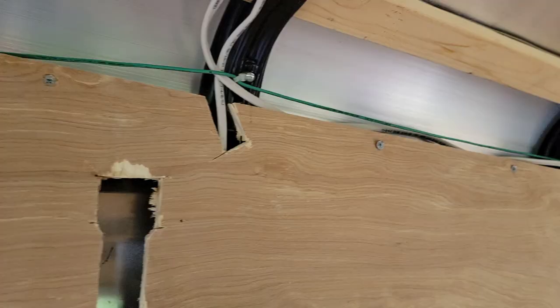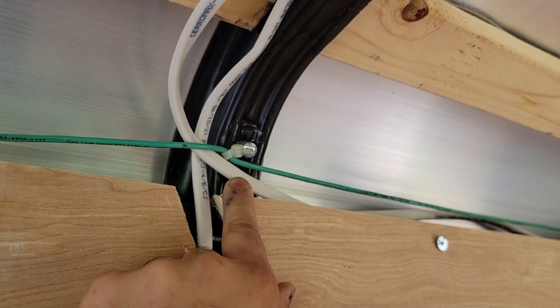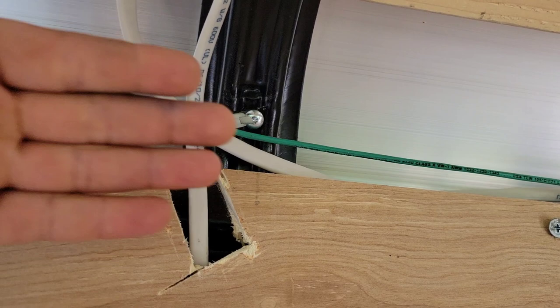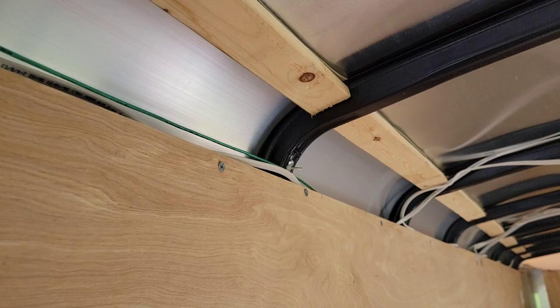One last detail — if you have little wire staple nubbies on your trailer or truck, take them off. Leave the wire just hanging by itself because those staples protrude out from the wall. When you run your stainless steel wall, they'll hit and prevent a flush fit. Take all these off so they stay nice and snug with the wall and you get a clean finish with the stainless steel. Just a small but important detail.